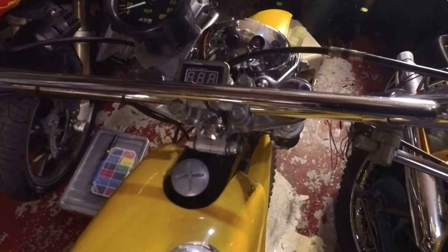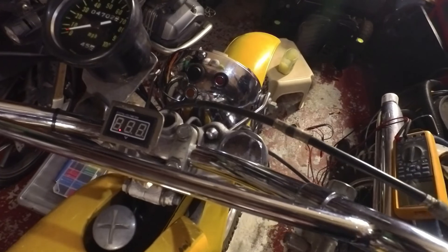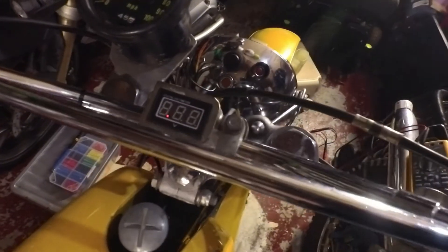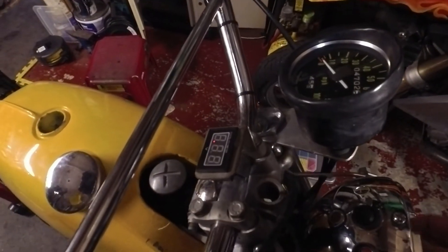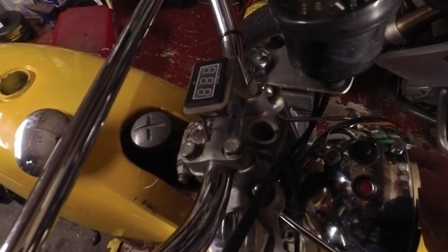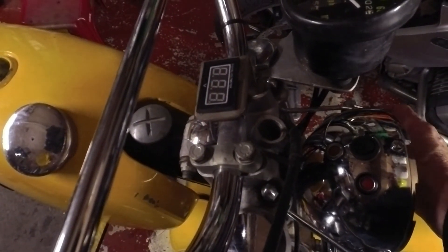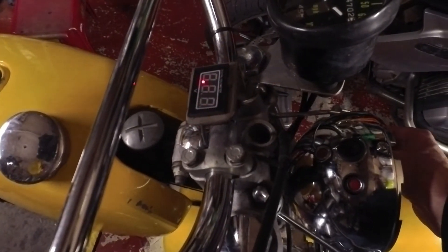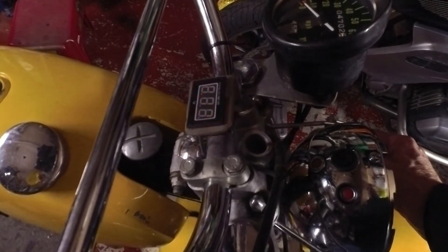When I ran the engine to do the timing, this seems to have blown up this voltmeter. I used to have this voltage gauge on my A65 BSA and it was quite handy just to see what's going on - straight across the battery on the A65 to show the battery voltage. I thought it might be useful on this since I had it knocking around, and a way of seeing whether I was going to blow up a lithium battery. Instead I seem to have actually blown up the complete meter. While the engine was running it was flickering wildly, showing various things, and each time I connected something different, something else seemed to happen. I think there must be a lot of noise on the electrics on this bike, and it's probably just blown up the cheap voltmeter.